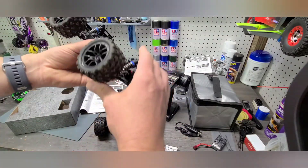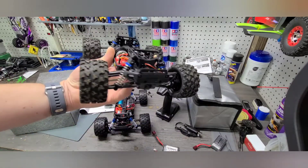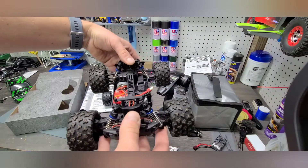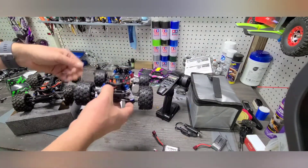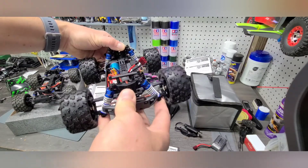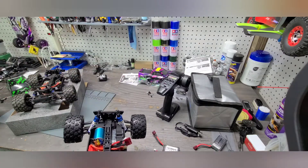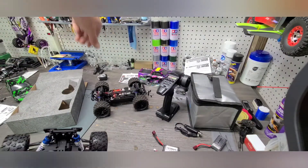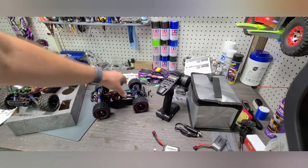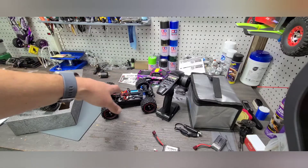One thing we called out on the original vehicle is that it has a friction damper with nothing to control the rebound. So it's very springy, and when you're jumping around on uneven terrain, it tends to get bouncy. What they did with the new version is they went to an oil-dampened, all-aluminum shock. Let me demonstrate — you see how the old one bounces in the back? Watch this one — it settles immediately. It didn't do a bunch of pogo-sticking afterwards; it literally sets down and stays well planted. That's really going to result in much better control when you're off road.